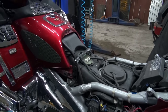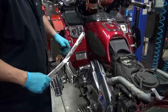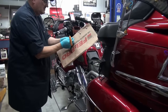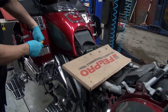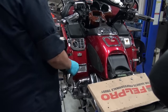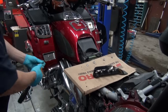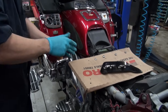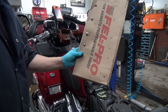Now we're going to start pulling off this stuff here, and then we'll start working at the top shelter. This model of GL-1800, you just pull the bottom out first, and there's little clips on the side. That's how they look, and that's where your bolts are going to be, so you start taking those bolts out there next. This is what I mean about indexing the bolts that come out of the shelter — as they're coming out, you put them in order. You just keep taking these bolts out. There's a bit of an oddball there, but that might have been because of the wing.